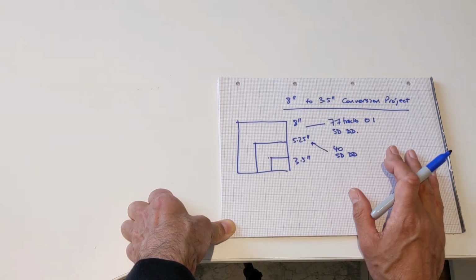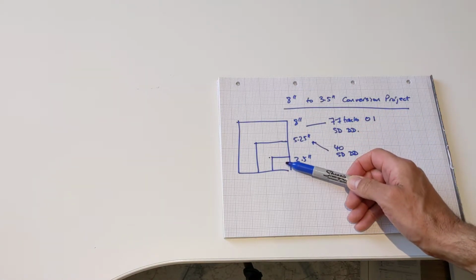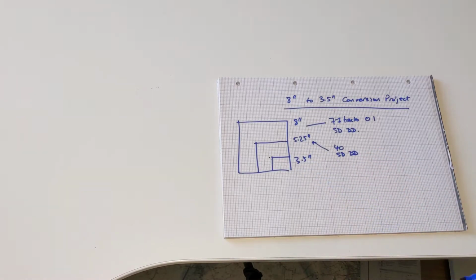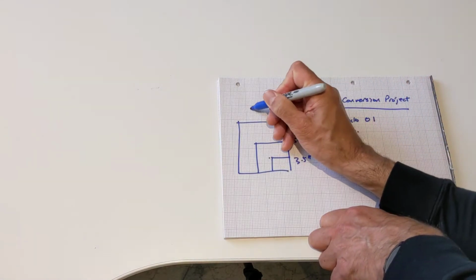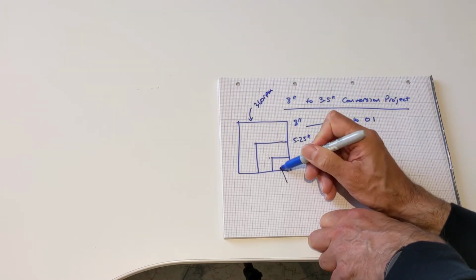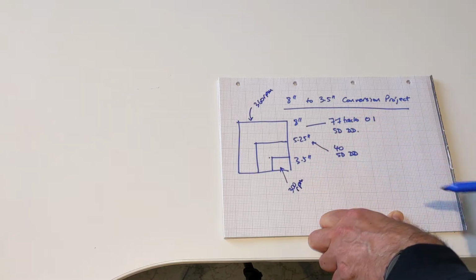But what came to mind in my research was that I looked at some of the vintage NEC computers that were made in Japan, and I found out that NEC moved from 8-inch diskettes to 3.5-inch diskettes. And how did they do that? They used a 3.5-inch drive which could spin at 2 different speeds. So the 8-inch drives spun at 360 RPM, and typically the 3.5-inch drives spun at 300 RPM, revolutions per minute.